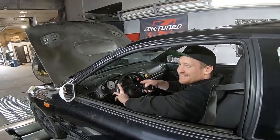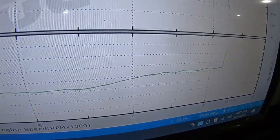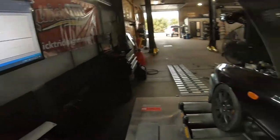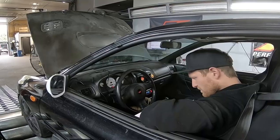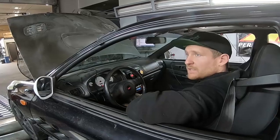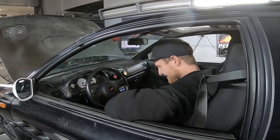Running out of fuel. The AFR is around 12 — running out of fuel up top. I'm going to see if I can fix it, ask for more fuel if we get no change. What's the duty cycle then? I forgot to log it. What was boost on that last run? 17 to 18 psi. So this turbo could probably do 400? Yeah. I can already feel myself getting greedy.